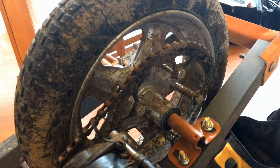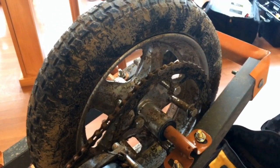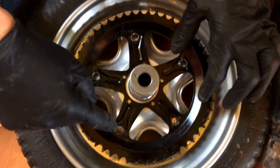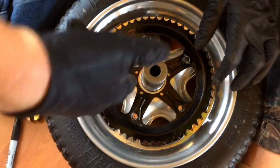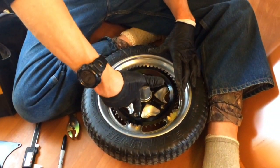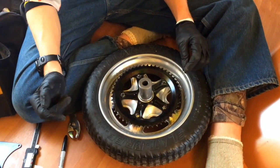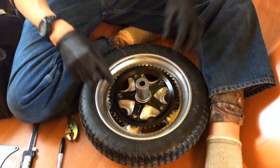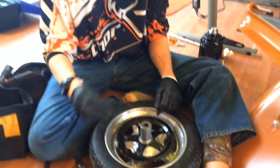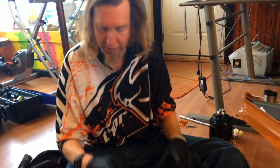When we spin the wheel we want this to be as straight and as strong as possible. The best way to do that is to have the shank go all the way through to the back side of the wheel. Doing the initial holes on this side, you do all five holes the same size as the holes already in the chain ring. Then when doing the holes through to the back side, you can take the drill with the big bit — you don't have to go progressively larger — and just right-angle it through the steel to the back side. Make sure it's straight up and down, that's really critical. Then we'll go back and re-drill the holes on this side just a little bit bigger so the shim can fit all the way through to the back side.